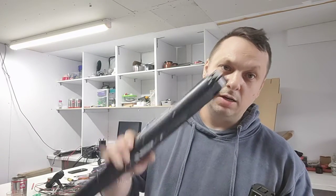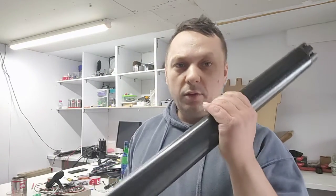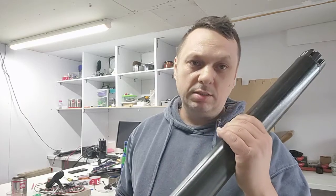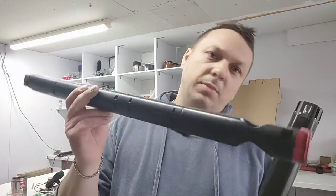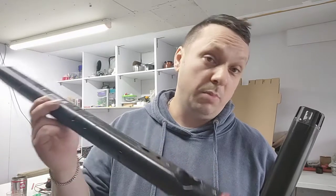So in order to know that this is good, you need to pop the charger in this first. It doesn't matter if it's in the bike or it's outside like mine — you have to pop the charger in without the main battery, because we sell refurbished batteries. So if it's about 70% and you put it inside the bike and you put the charger, this might take a few hours to wake up or it might not wake up.